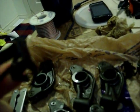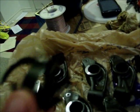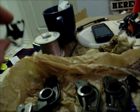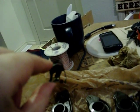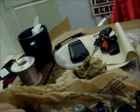These are the spacer clips that go in between. I actually put these on wrong the last time I pulled the rail out. The spacer clips need to be pushed where the closed side is up against the spark plug tube so that it can't accidentally pop up. If you have them the other way, you can actually pop them off with a screwdriver, and that's not good because the rockers are moving up and down, and it could potentially shake this thing loose over time.